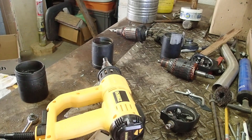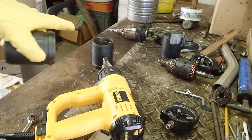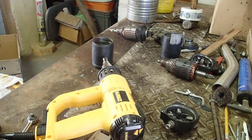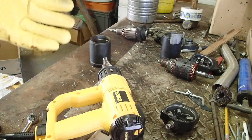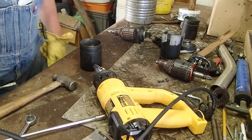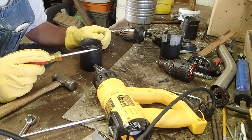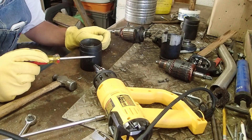I'm experimenting now — trying to see with that heat gun if I can get in there and heat those magnets up to bust them loose. This is one that the magnets are already all broken on. I mean, if I break one of these magnets, it ain't a big deal. My heat gun is as high as it'll go, which is 1100. I don't really have the right gloves, but this is just what I got. I think I can get the magnets loose, but what I'm afraid of is they're all going to come loose because I'm having to apply so much heat. When you heat magnets up, too, they lose some of their magnetivity, so I might actually be ruining these magnets when I do this.